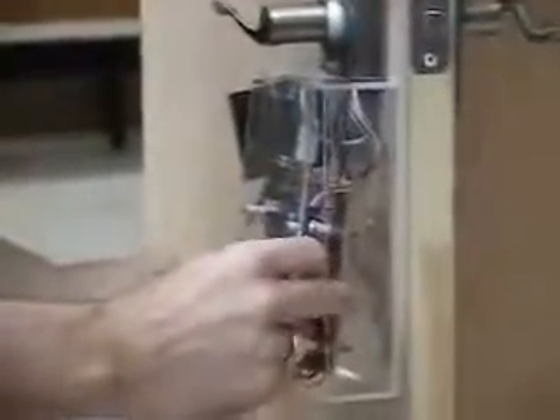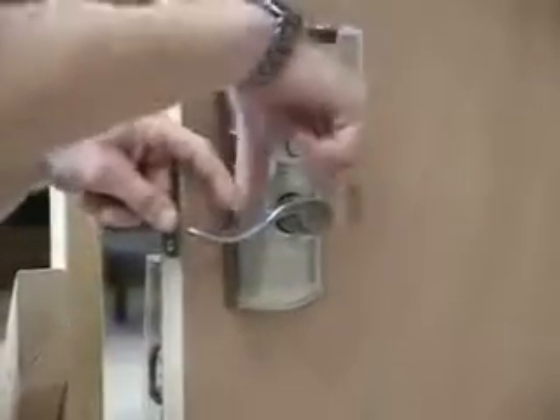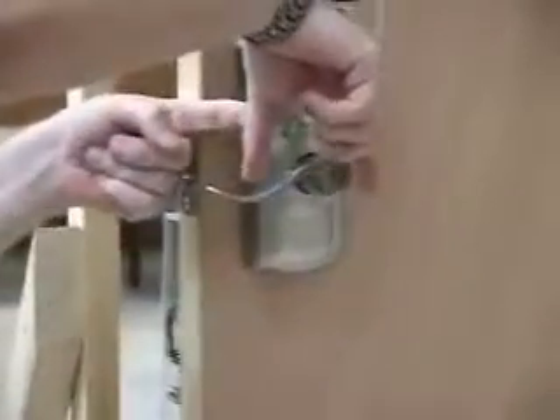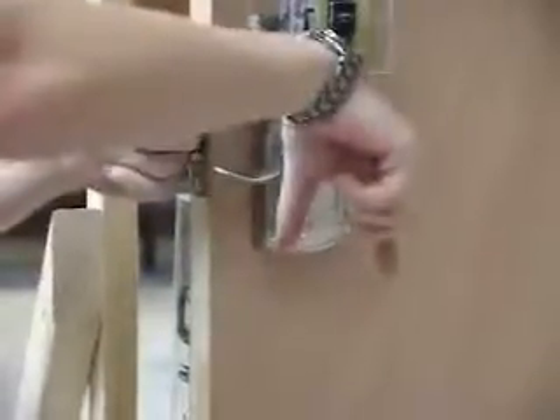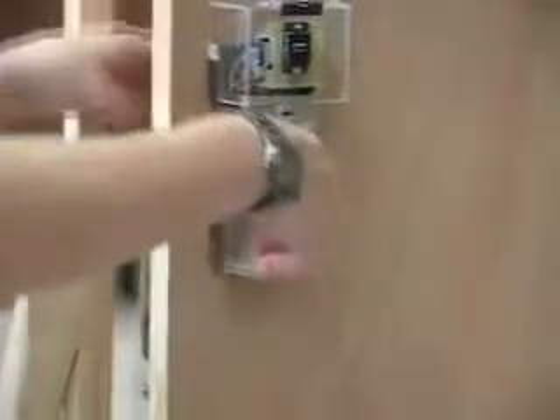The locking mechanism is on the front side. There's a motor right here, and there's a spring, and then there's a piece of plastic that's keyed on the spring. When it spins one way it'll push down, and when it pushes down there's a pin that engages on the front handle, allowing it to turn both handles at the same time. When it spins up, the pin removes and only the front handle turns. That's how the motor works.